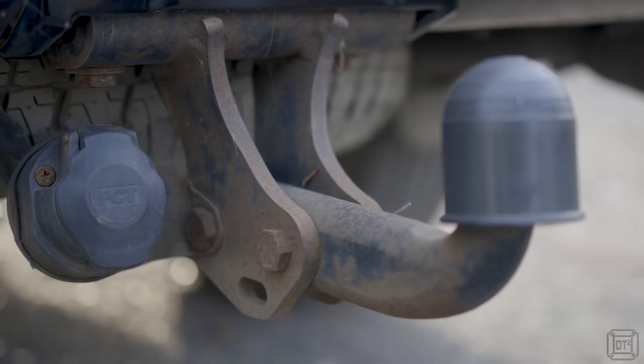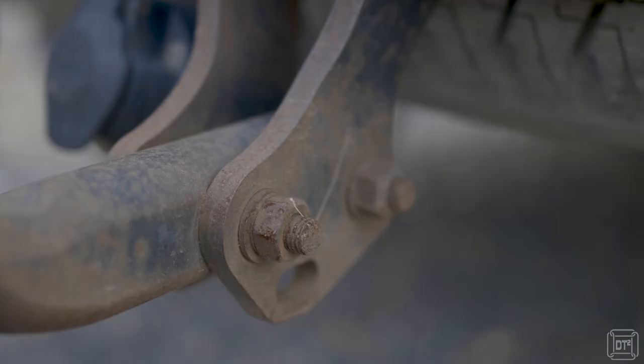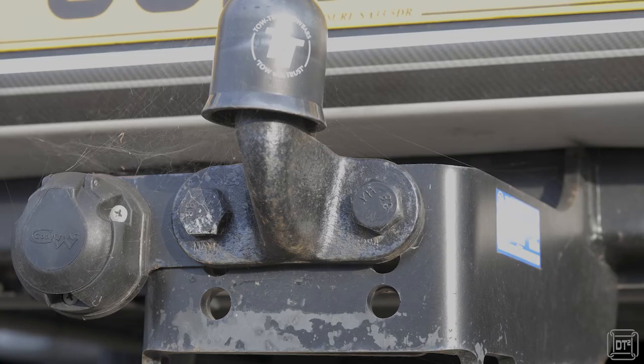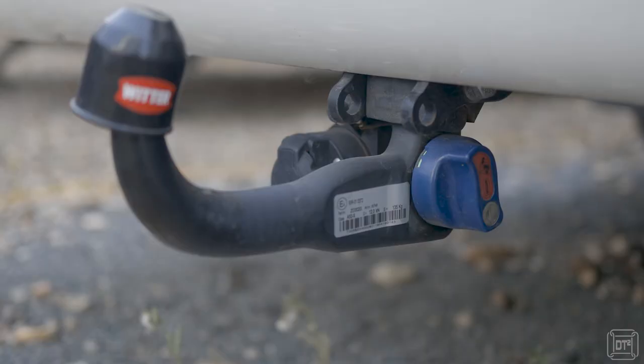What we found worked was effectively removing the tow bar from the back of the car. On my particular tow bar setup, there are two bolts that go through — you take those two bolts out and the tow bar comes off. Once it's just a tow bar attached to the caravan, you can drive around in the car to get spare parts, and you'll find you can freely waggle it around and it will come out because there's no tension on it. If you've got the plate-and-two-bolts style, you just undo those the same way. For detachable tow bars I'm not sure if that would make life easier or more difficult as I'm not familiar with that mechanism.